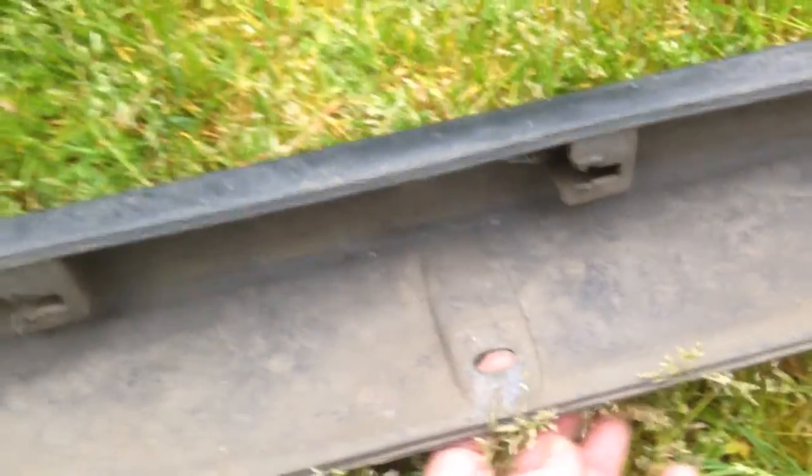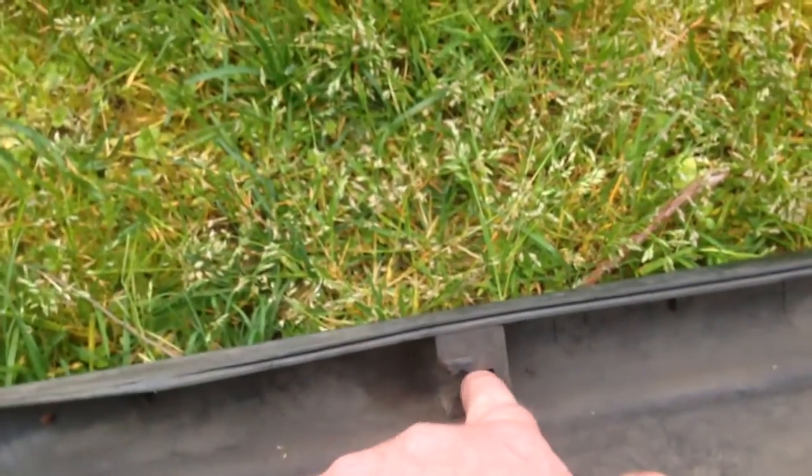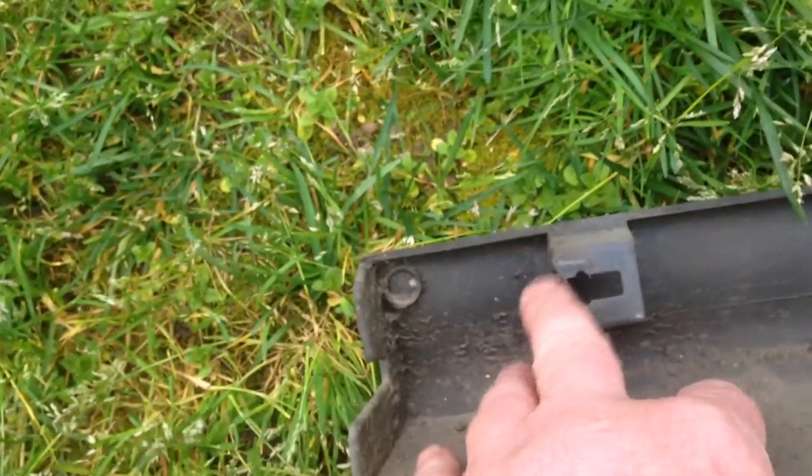You just want to be careful. Here's that one I took off — you can see the push-in clips go through the bottom and hold it to the bottom of the car, and there are little clips that go in right here. The front has a screw here and a screw there; in the back it won't have anything, you just push from the back and the whole thing slides off. When you put it back on, shove it back and it slides into those slots, then put the screws back in. That's how you take the side skirts off your Honda Civic.